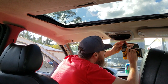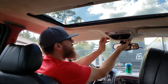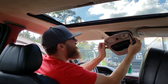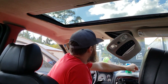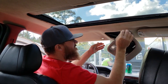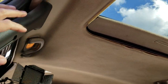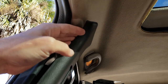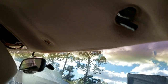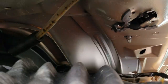I didn't see it, but there's a screw right here. This upper center console thing has got one screw in it and it just pops out, and what that's doing is allowing me to drop this down. Quick overview: I took off this piece, snapped this out, pulled this out, took off the grab handle, took off the visor, and now I can drop it down.